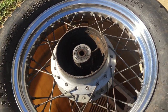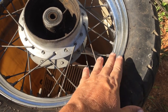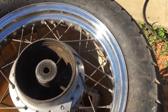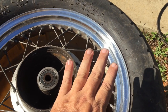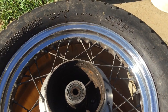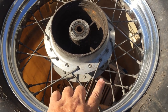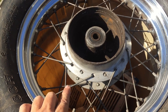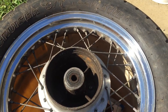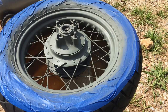All the grease is off the wheel now. Take a piece of sandpaper — I'm going to use a 120 — and go around the chrome part and scuff it up pretty good. You're not going to get rid of all the chrome; you just want to dull it down a little bit and get some grooves into it so the etching primer will help it stay on there. Also, you want to try to sand down the spokes a little bit to get any residue off. We'll go ahead and get all this sanded down and check back when we get ready to tape it up.